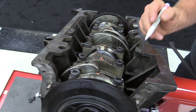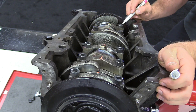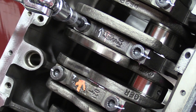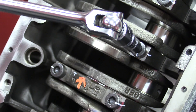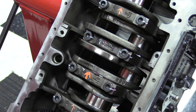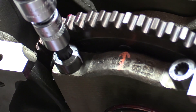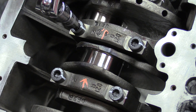Next, we're going to do 180 degrees — that's the stretch part I talked about earlier. I like to mark my bolts for that 180-degree turn, which is half a turn. It's always recommended to use a torque angle gauge to achieve that 180 degrees. Whether I'm using a torque wrench that does angle, a separate angle gauge, or eyeballing it, I always like to put marks on the bolts. That'll allow me to quickly look and make sure I got my half turn, and also allow me to do a quick recheck. Rechecking 30 newton meters is very easy; putting an extra half turn on something if you're not sure could result in a severe overtorque situation.